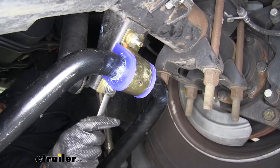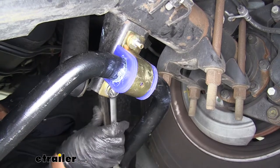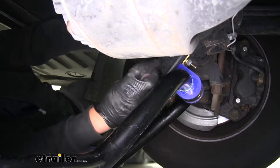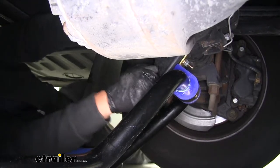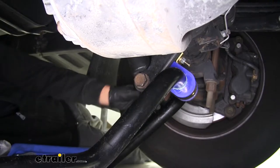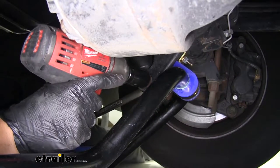We'll go ahead and tighten all of our hardware down. I'm going to come back with that same 7/32 Allen socket and a 9/16 wrench and torque down my bolts behind my shock before I put the bolt back in place. We'll torque the upper bolt as well. Then we'll take our shock, put it into position, and put our bolt back through — just make sure you have that washer on the bolt end. You may have to use a little bit of force to get it to come back through the other side of the eyelet. We'll get another flat washer, slide it over, and finally put the nut back in place. Grab our 1-1/8 inch wrench and socket and tighten everything back up.